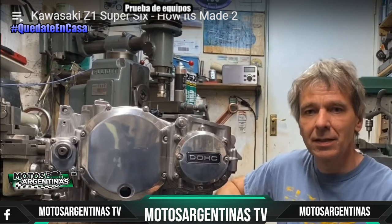With the first bend complete, I offered it up to the engine and it slid lovely in place and engaged perfectly with the starter motor cover. I then used a steel rule and a marker pen to mark a line for the next bend. I then placed the cover back in the vise to complete the second bend, first checking that the scribed line was exactly in line with the vise jaws, so I get a nice crease and a nice bend.